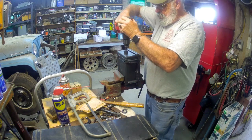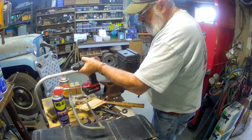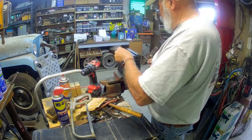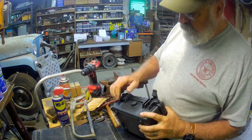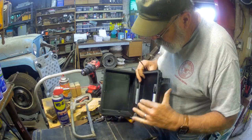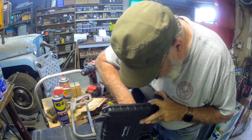The fuse panel will actually be mounted on the inside so the box can be closed up. Previously took the handles off because I'm not going to be carrying it anywhere unless it's hooked up to the Jeep. After drilling the hole out, I get the rubber grommet seated in place. I'm going to be running the wires through that grommet and then through another one in the firewall to bring them up into the dash area. All the rest will follow the frame or go to various areas of the Jeep.